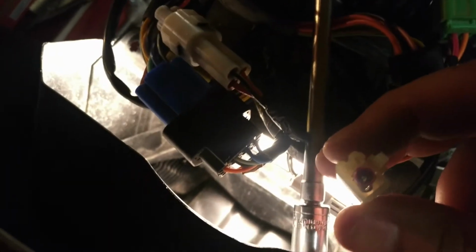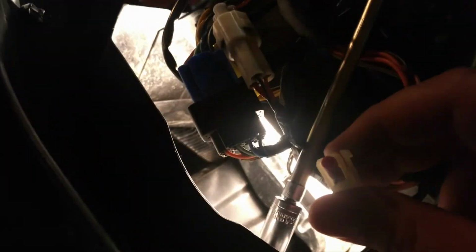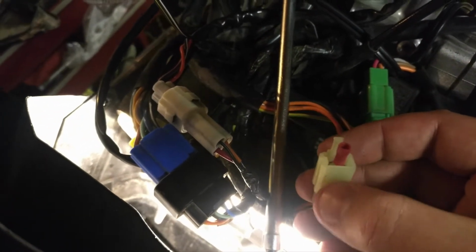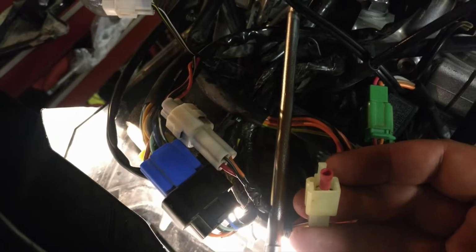Well, to bypass it easily, so it doesn't happen to you while you're on the road, you just take a flat crimpable electric end, and you can just pull out that cable. Of course, you're eliminating some cable from this cable mess. Then take a flathead screwdriver, widen up the end down here where it would normally crimp onto a flat end, and push that underneath the two connectors.